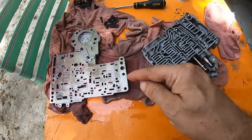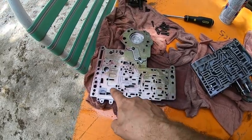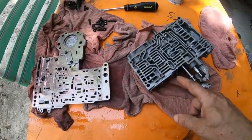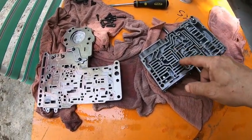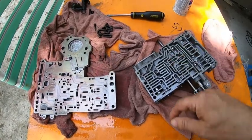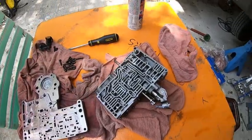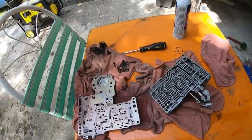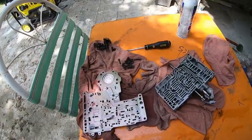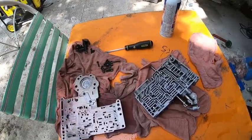And then I gotta start. There's instructions they tell you. Some of these holes you have to enlarge. They give you drill bits for that. Some parts of this, they give you a plate to bolt in, a drill guide plate, and then you take a drill into there, and then the part here you grind, you file off too. So yeah, it's a process. I'll try and show as much as I can until those guys get back.